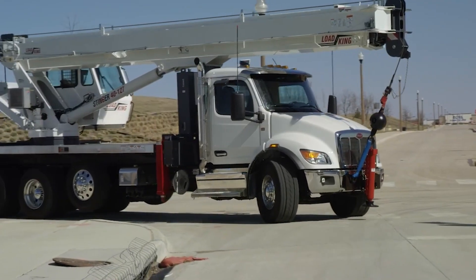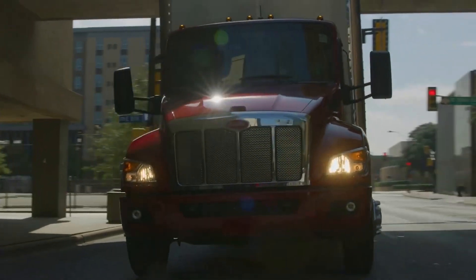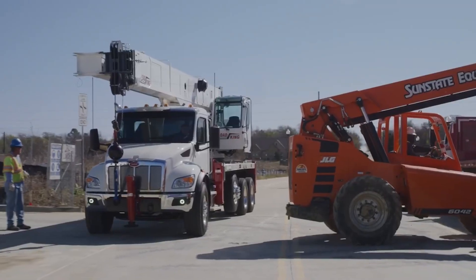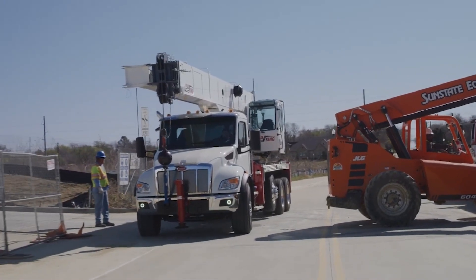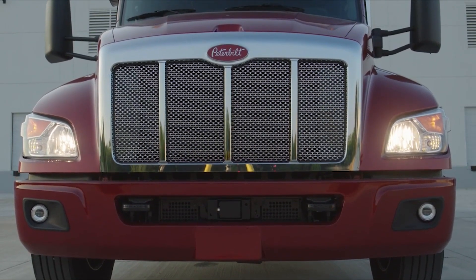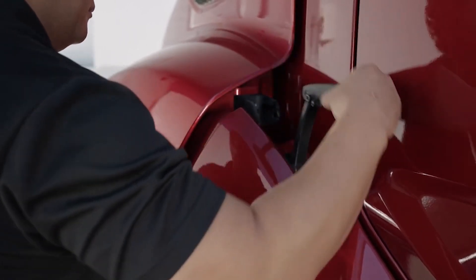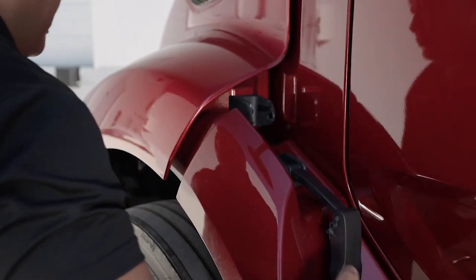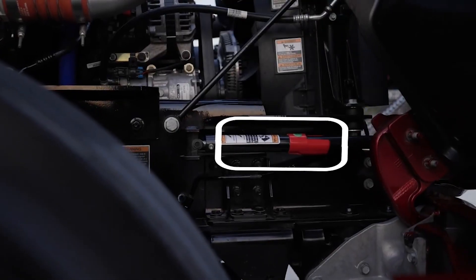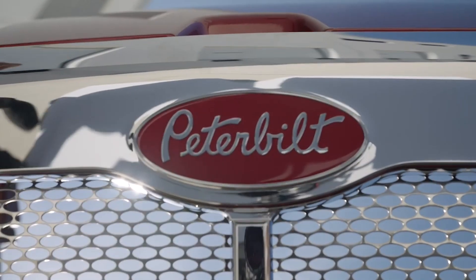Your Peterbilt new medium duty truck will require basic maintenance to ensure uptime and longevity of the vehicle. These simple tasks can be done without the help of a licensed professional. The hood is secured by two external latches. To open, pull the latch up and towards the hood and lift the latching mechanism out of its housing, then carefully tilt the hood forward. The anti-blowdown lock cylinders make certain the hood stays up while accessing the engine.